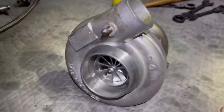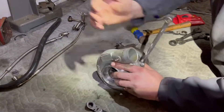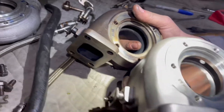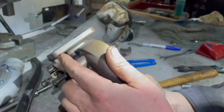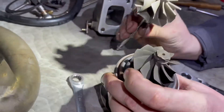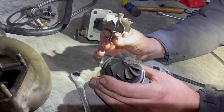What's next? Take off the housing. We just loosened up all of these bolts. Got the O-ring. Here's our wheel — we got a lot more to do first. Brand new Garrett. You can see up here pieces broke off too. There was definitely some contact in there — probably because I'm running 40 pounds of boost on a small turbo. This is a 9 blade, that's a 10 blade. So this has one less blade so it flows better at the top. It might spool a millisecond slower, but it's gonna have better flow at the top end, which means less heat.